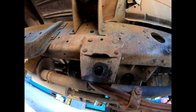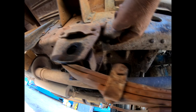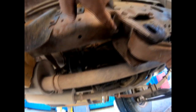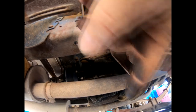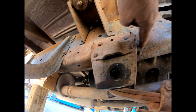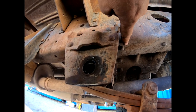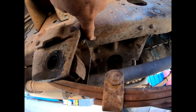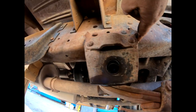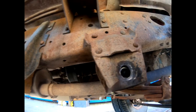The new bracket has four holes on the underside to fit one, two, three — but there's not a fourth one on this one, and there may not be one on the other one either. I'm going to have to pull this rivet or the bracket won't fit. I'm going to have to grind this rivet off that fits this crossmember, and cut this whole bracket off because it's welded on.